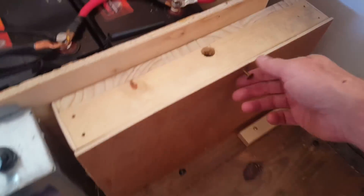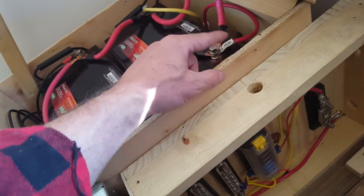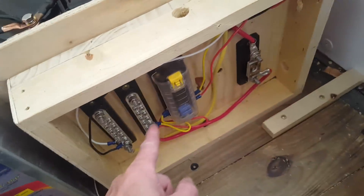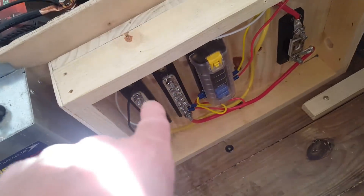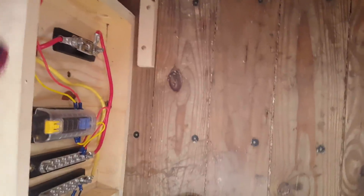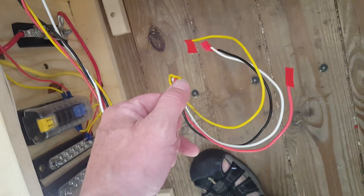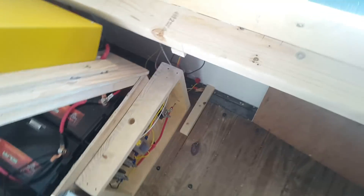The other part of this electrical system is my distribution panel down here. Coming out of the back are the red and yellow wires — they're fused off there, go into a fuse block and some power blocks. I can run wiring off of there to different places. Right now these are the wires that went to some lights I had — I clipped them when I salvaged this out of my old van — and I'm going to hook up my lights in the next day or so.